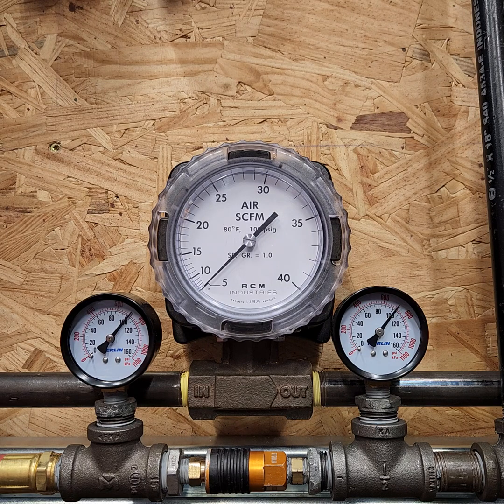So we'll start, oh, by the way, I've already adjusted the rig to run about an average of 90 PSI dynamic pressure at the tool. Each one obviously pulls a little more air, so it's just kind of a working average. Downstream, I have all these hooked up with a quick coupler at the end of a very short, like 3-foot, half-inch hose. So while we do now technically have 2 couplers and plugs in the system, we've only got 3 foot of hose, and under normal circumstances we'd be using 25 feet or 50 feet of hose on a reel. So I think it's a fair trade for me to be able to quickly swap the tools in and out.